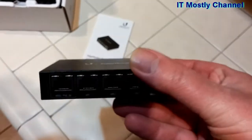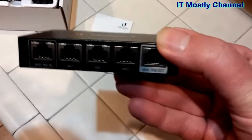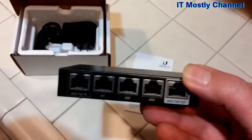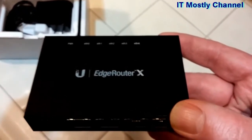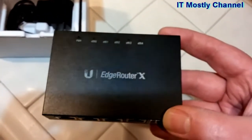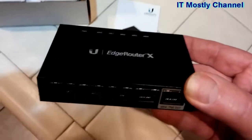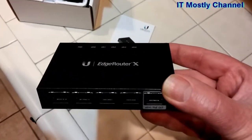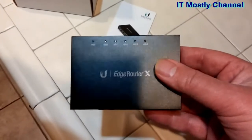The EdgeRouter X should be good for up to a gigabit connection from your ISP, though there have been reports that this router can top out at 500 megabits on gigabit connections to the ISP. A lot of people have been moving up to the next step, the EdgeRouter 4, which apparently can handle gigabit and higher WAN connections. Few people get actual gigabit speeds from their ISP, but if you can get 600 or 700 megabits and you've got a router limiting you to 500, you kind of need to do something. For me, this will be fine — I've got a sub-100 megabit connection, so this should be wonderful.